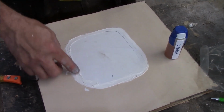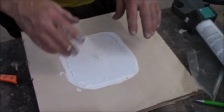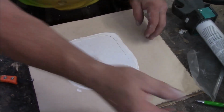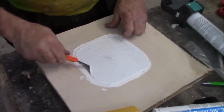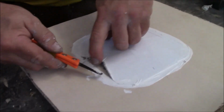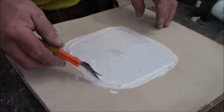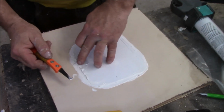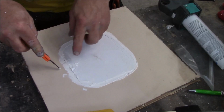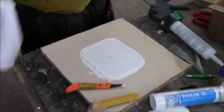This is going to be a little more permanent of a patch than just that plug that we did when it was raining. So now that we get that all done, the whole purpose of it is this part here. This part underneath here, that's a butyl. When the sun hits that, if you didn't have the caulking on there, it will cause it to release and curl up just like I'm doing here, and it'll start coming loose. That's why you need the primer. That's why when you prime it, you're going to prime on top of this, because nothing will stick to it. The caulking will not stick to this patch, and it won't stick to the roof unless you use the primer. That's how you do a patch. Ta-da! All done.